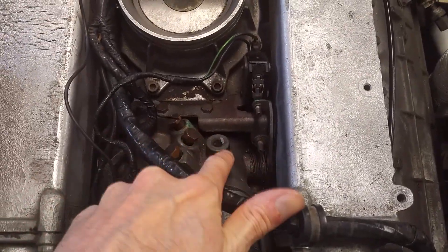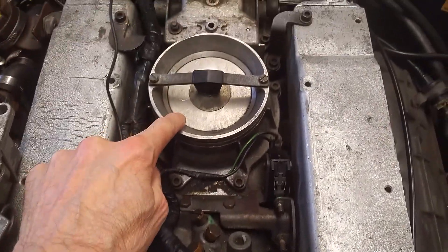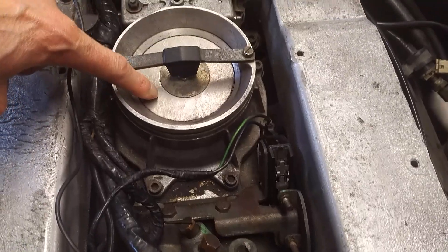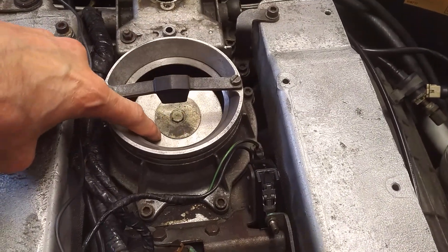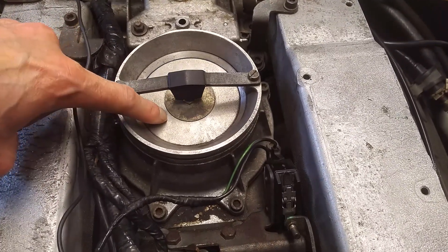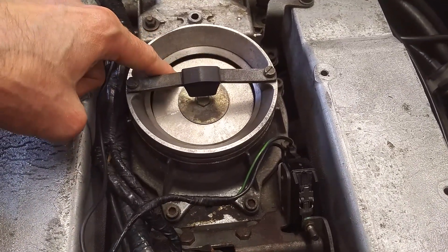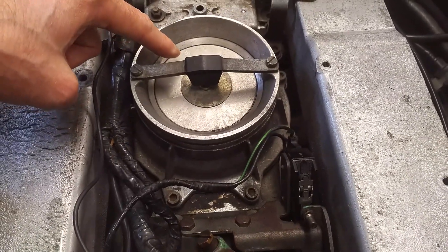These are our throttles here and they draw the air through underneath this plenum, and as the air comes in it pushes this flap down. This is mechanical fuel injection so there's no clever electronics doing this. It literally meters by how far this is pushed away, and the relationship between this step here, this little chamfer here, and the shape of the plate is very very tightly controlled.